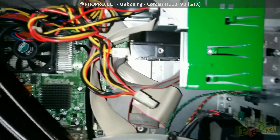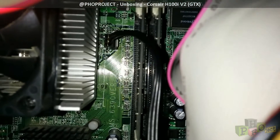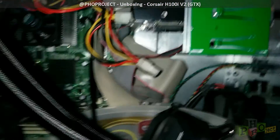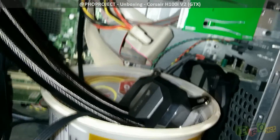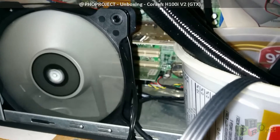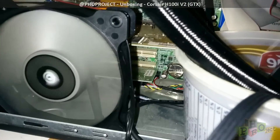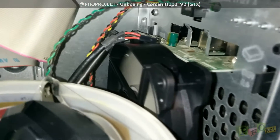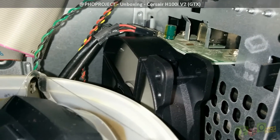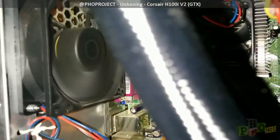Slight change: we're connecting it straight to the CPU fan connector, right between the RAM and the CPU heat sink, to see if the noise of the fan is going to be increased. The speed of the fan seems to be stable — not faster or slower than before. The same here for the fan on that location. This is the case fan; we put that back on. It's roughly the same. This one is actually running slightly faster.